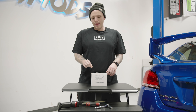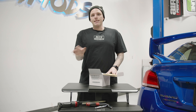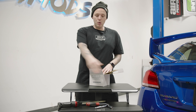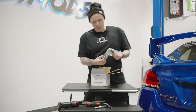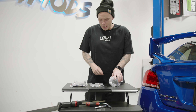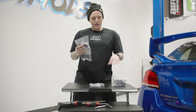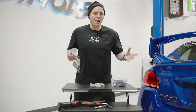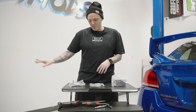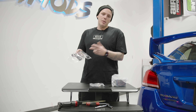Diving in here, we're going to start with the product itself. Molded Innovations offers pretty much everything you're going to need to get this installed right off the bat. It's a great kit — everything you need is in the box and the tools you need are very simple. These are plug and play. It's literally one connector to the taillight, one into the brake light, one into the other side of the connector and you're wired up. Older kits or different manufacturer kits used to require splicing and T-taps — we're not doing that. Easy plug and play. All the hardware you need, some zip ties to keep it clean, and the bracket — you're good to go.